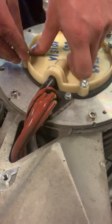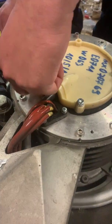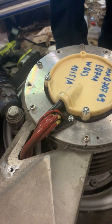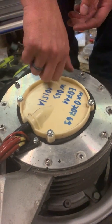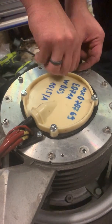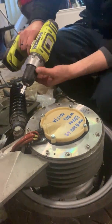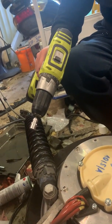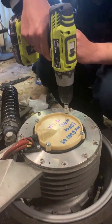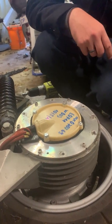Make sure the seal is actually on the inside of the plastic cover — sometimes it will poke out, and if it does it's probably not going to seal very well. Once you've got all the bolts in a couple of turns, you can buzz it back down with a drill. If you're using an impact drill, make sure you torque-limit it, because it's usually steel bolts into an aluminium housing and it will strip the aluminium if you put too much torque through it. Or you can just do it by hand — but again, don't over-torque it.